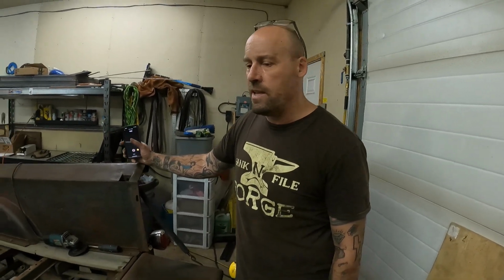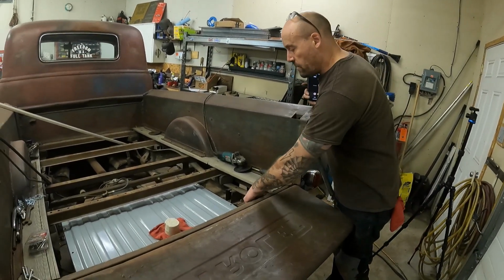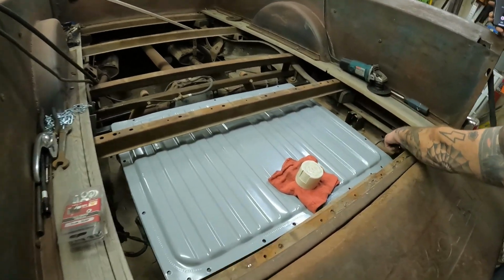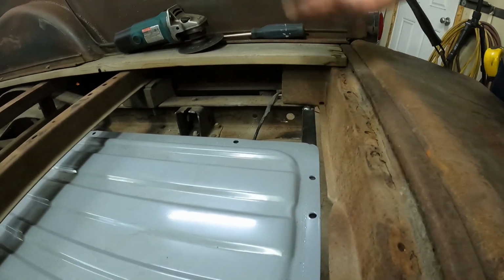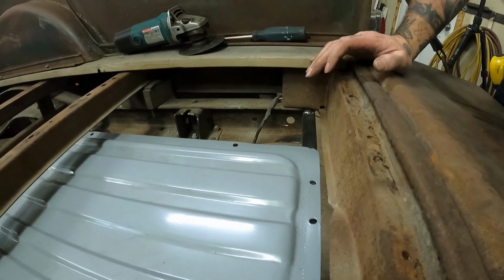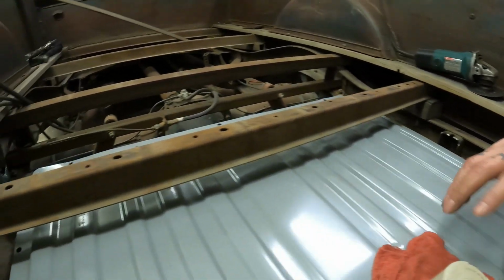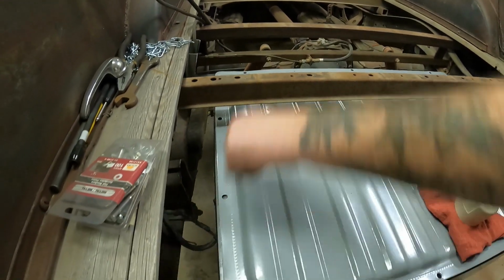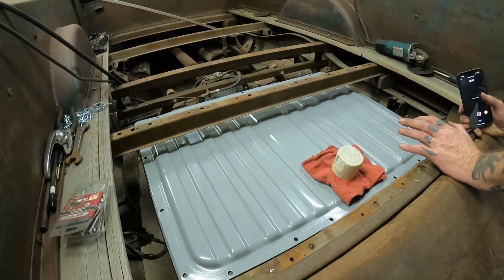We had a little problem. The battery died on the camera, so we got that charged up and we're back in business. While we were doing that, we took the 1-inch steel that we had tacked lower on the frame and raised it to the top of the frame. It's just tacked in right now. We raised it to get a little more height because I felt it was too low. It's a little better aesthetically higher. And then we put in cross braces to go this way, so everything is supported on the perimeter. Just tacked in, we're going to weld it up shortly.